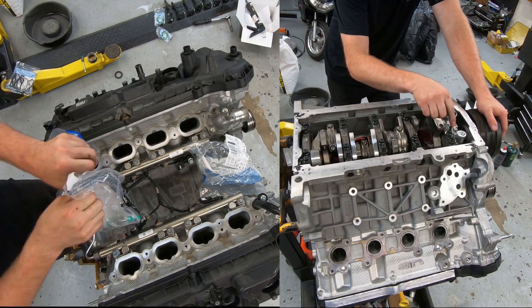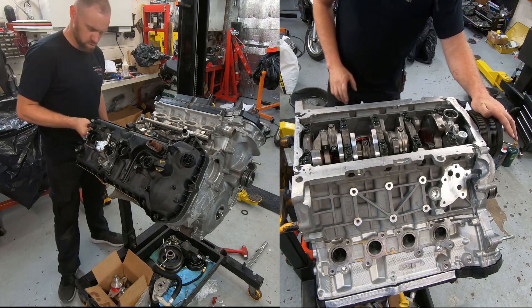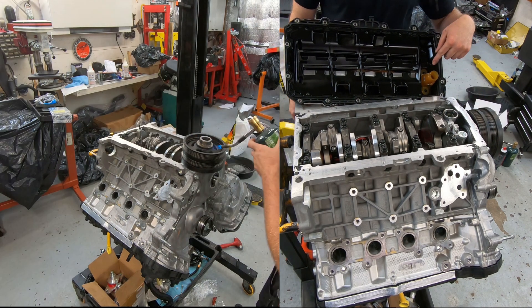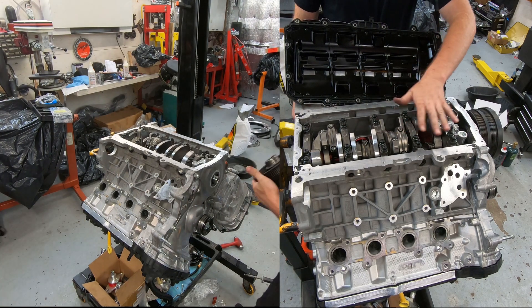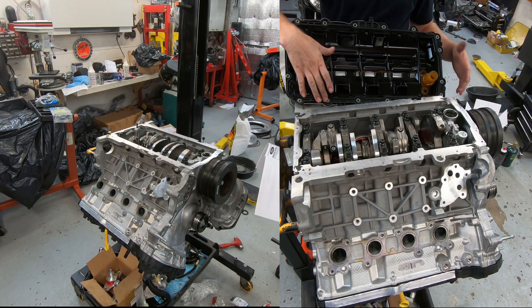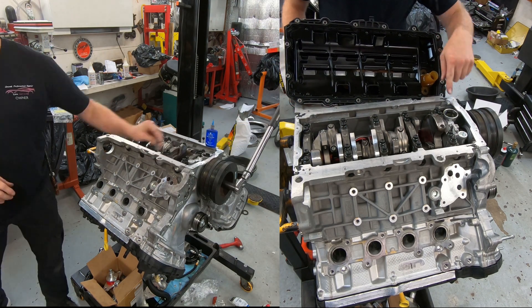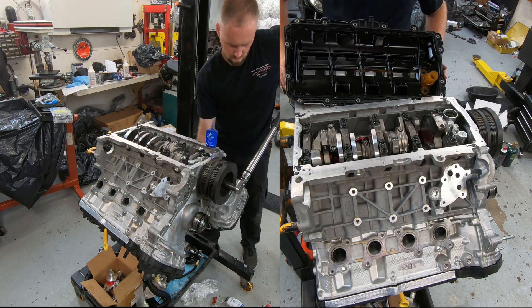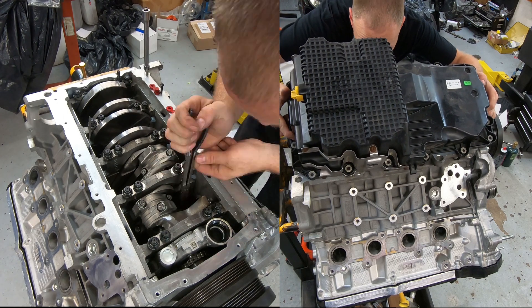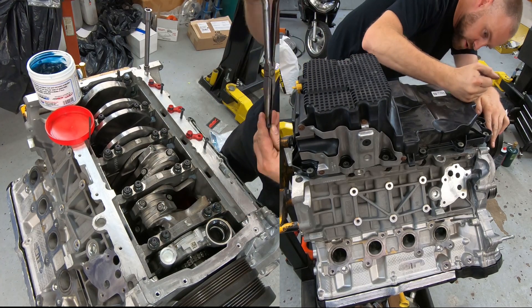As you can see, I had to move the stud — I ended up moving it over here. I was going to put it in another spot but realized it comes really close to the baffle, and once the gasket squishes down it would hit the plastic. Over here it should land in a safer area. I also filled that area with oil so I can kind of prime the system — I'm going to prime it right before or right after I put the oil filter on, turning it over by hand just a little bit.